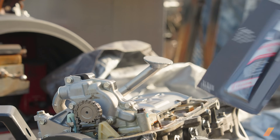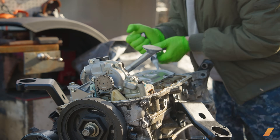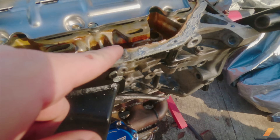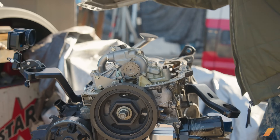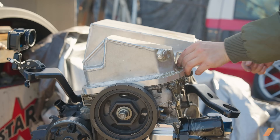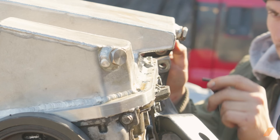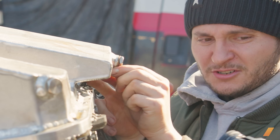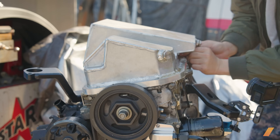After test fitting my new oil pan, I was happy with the results and got out my Honda Bond, which is one of the stronger sealants you can get — you cannot just use regular Permatex silicone RTV here. Get Honda Bond, thank me later. On the perimeter of the block there are a couple of studs, so I put a big glob of Honda Bond in there. Once the oil pan was seated, I got out my brand new hex hardware and ran into yet another problem — these rear-wheel drive K-Swaps have oil pans that have to clear a lot of stuff under the hood, leaving little to no room for the Allen key to tighten down the bolts. But it's a game of patience.